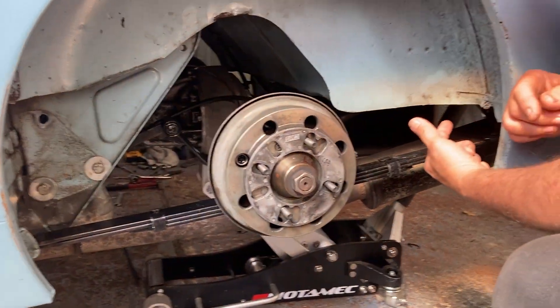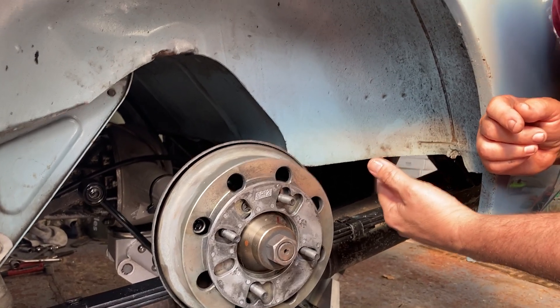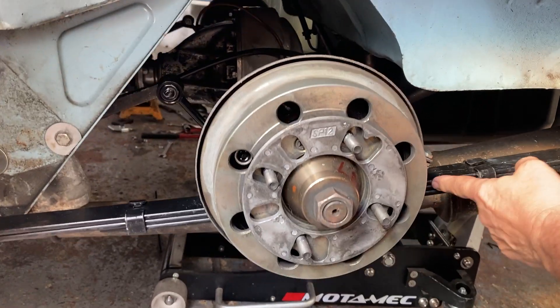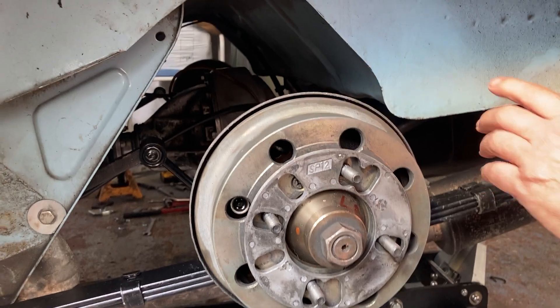At the back end you have to re-drill it to fit the rear shackle mounting plate. We could not get the right springs from anywhere, so we made our own. They work well.